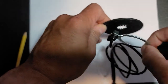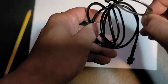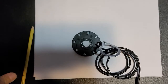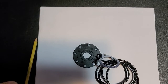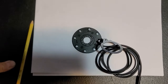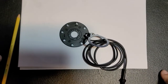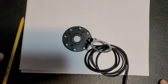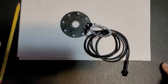In order to regulate it, you need to wire in a switch on the sensor, and you also should have your brake cutoffs wired up as well. I know a lot of people like to disconnect their brake cutoffs, but the brake cutoffs really are a good safety feature. And I wouldn't recommend doing this modification unless you have your brake cutoffs hooked up. Now, like I said, you don't really need it, because I'm going to also recommend a switch. You've got to have a switch for this.